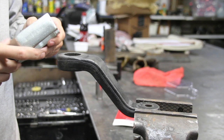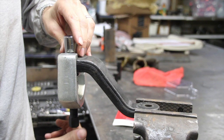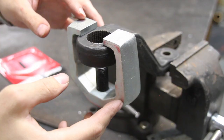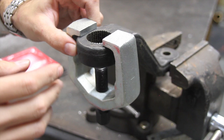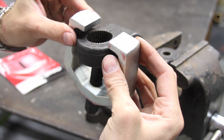You've probably seen me use one of these. You put it on there — there's a shaft that comes down — and you turn it, and what it does is pull the pitman arm down while pushing the shaft up, so that it separates the two. The problem with these cheap pullers though is that if the pitman arm is stuck on really tight, what will happen — I'll inlay a photo or video of this — is when you start cranking down tight, it pulls so hard that these arms start to bend outward and it will bend so far that it just slips right off.